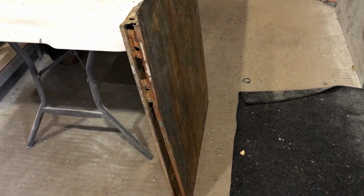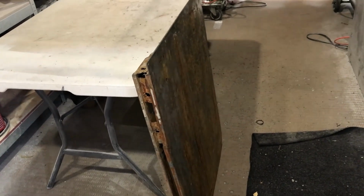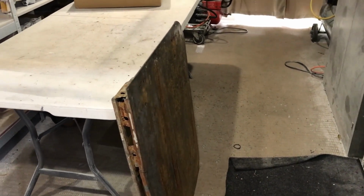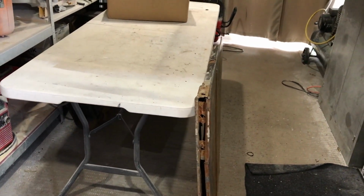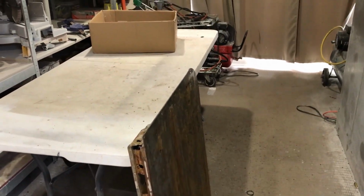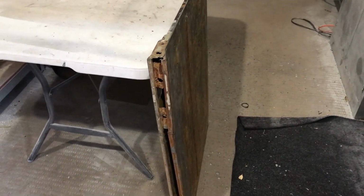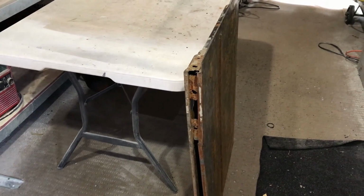So that's the plan. Weld it up, get it all straightened up so the welding's finished on this door. Put it back in for a day or two, clean all that flash rust off, pull it out, phosphoric acid it, then do my bog repairs and nicky repairs, and then put it in primer and grab the other one. That's where I'm at.